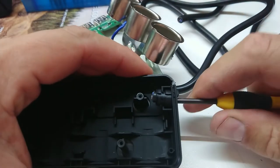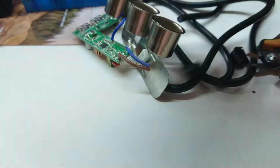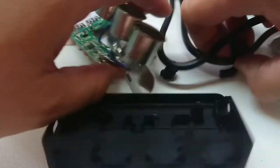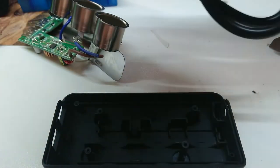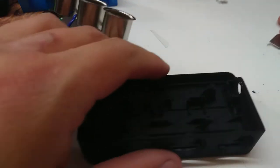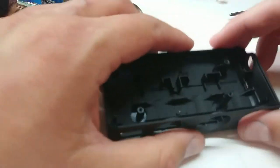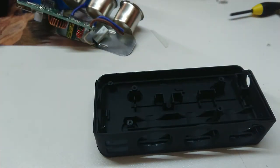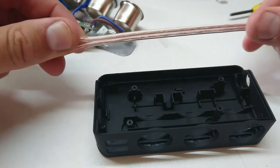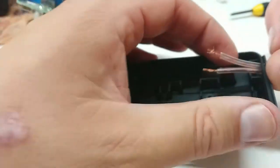I think we're going to end up with a heat shrink and hot glue strain relief in this one. So just slice the end off and push the rear out. Now we get rid of this horrible cable — I'm not even going to reuse that. My apprentice is going crooked on Roblox again, you can hear screaming in the background. Now we are going to use some OFC cable — this stuff has got bigger conductors than that big thick stuff you saw before, and it's much better behaved. I'm going to thread a bit of this through.